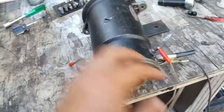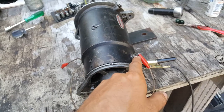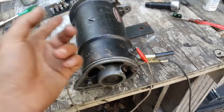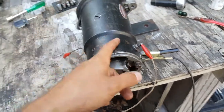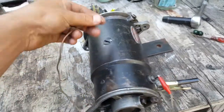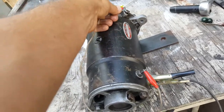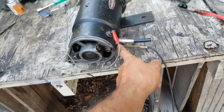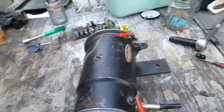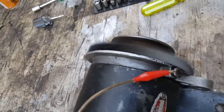Since one of the brushes is connected to the case, it has to be connected to ground. I could put two ground leads — one here and one to the housing. Remember this here is insulated, so we need a terminal here, but electricity will still flow through the system. I'm just going to connect this jumper cable to that little tab, and one terminal to the A, the other to the housing. Once I tap this it should start to spin — and sure enough, there it is.